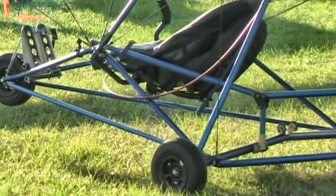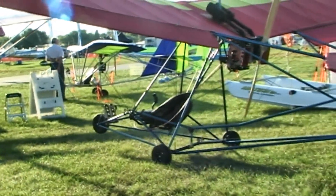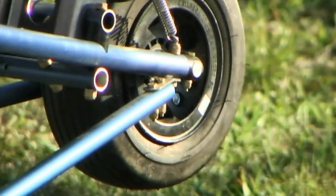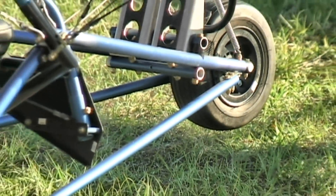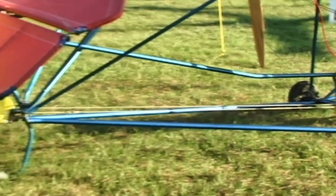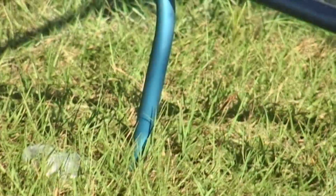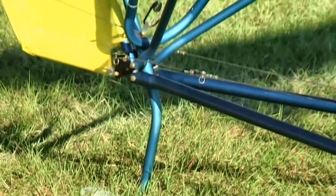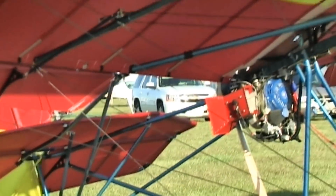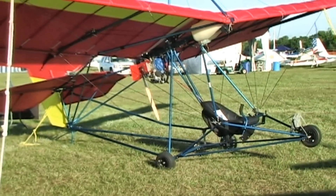On a little plane like this, this engine is capable of about 320 pounds of thrust. So you've got a 250 pound plane, and it pretty much climbs straight up. Yeah, a 50 horsepower single-seat Quicksilver — it used to do okay with a 15 horse Yamaha a long time ago, would actually get off the ground. But this is more than three times as much power. That is going to make this airplane perform — they're going to climb like crazy.